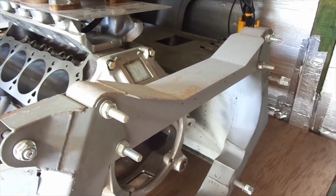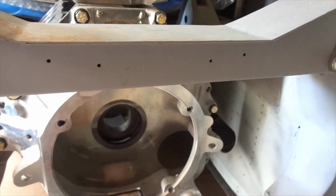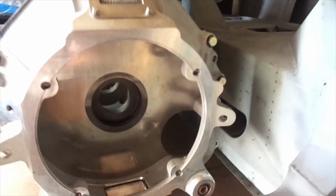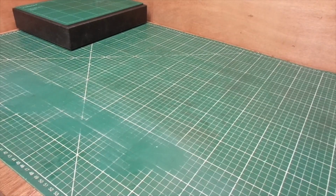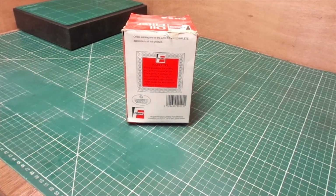Thank you. So, to summarise where the engine gearbox assembly is attached to the chassis, there's going to be 2 metallastic bearings in there, attached to 2 lugs on the upper part of the gearbox. The 2 lugs there on the lower bell housing, and we've got the 2 engine mounts as well. So, here we go. Gearbox. Oh, empty bench. Engine is in the chassis. Hurrah.